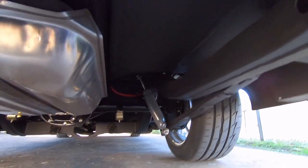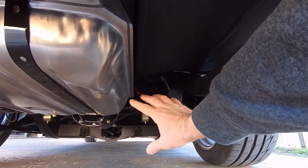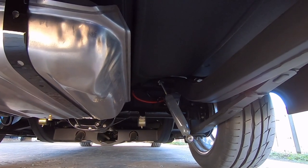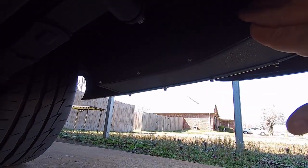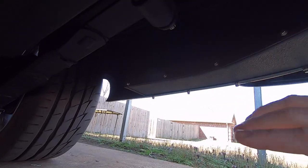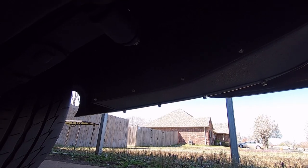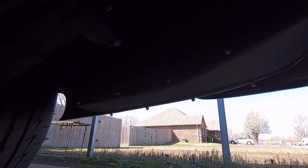There will be a sway bar going in the rear brackets. The rear end center section was decasted, smoothed, blocked, and painted. I also did the rear end girdle cover. I built drop-down boxes with covers back here — custom made with corners because originally this area was rounded for the splash apron. The problem was you could see up inside the quarter panel with lights and mirrors, so the drop-down boxes block that view.